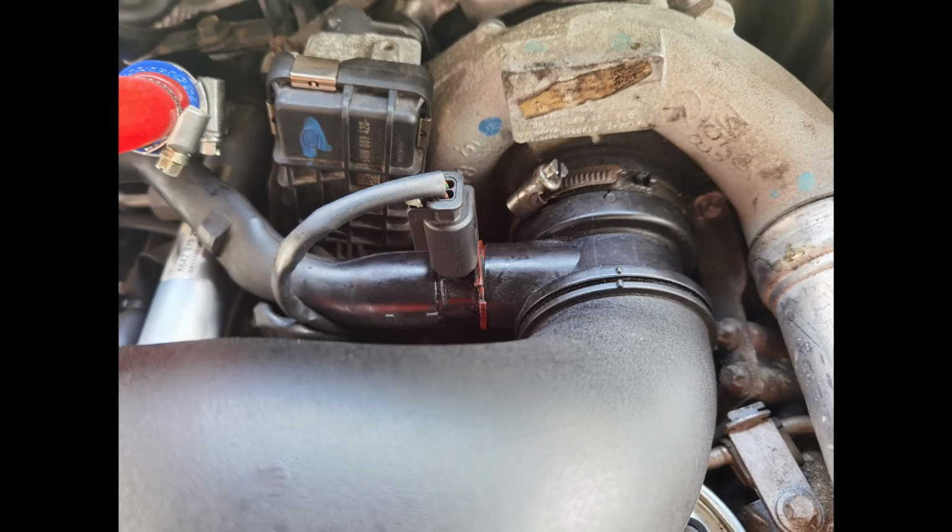Okay, now to fit the pipes. First, remove the large air pipe by loosening the Jubilee clip at the turbo, and at the airbox. Then loosen the bolt that secures it to the engine block. Pull the small CCV pipe out near the turbo and then the whole pipe should come off. Also remove the electrical connector on the CCV pipe and remove that too. Put it to one side for now.